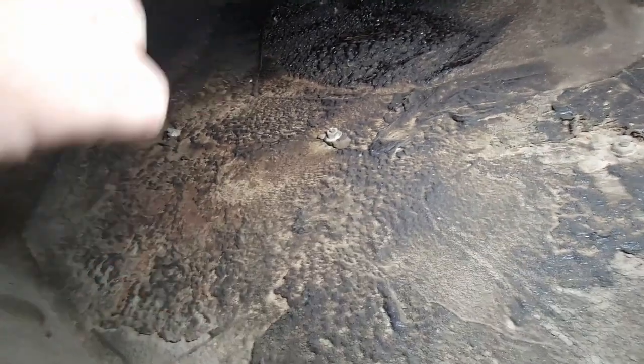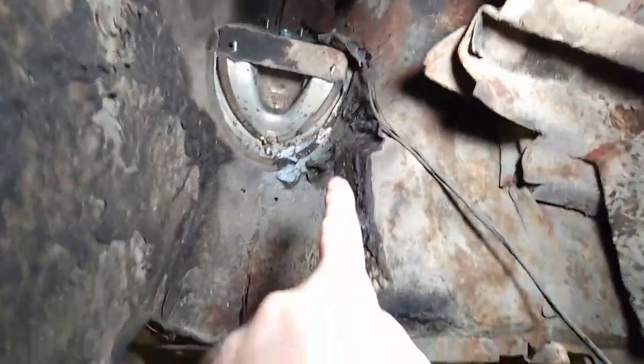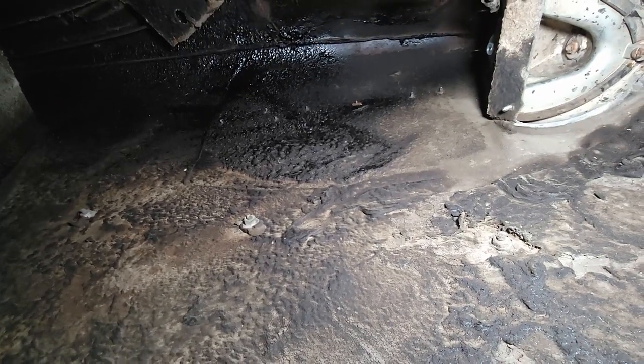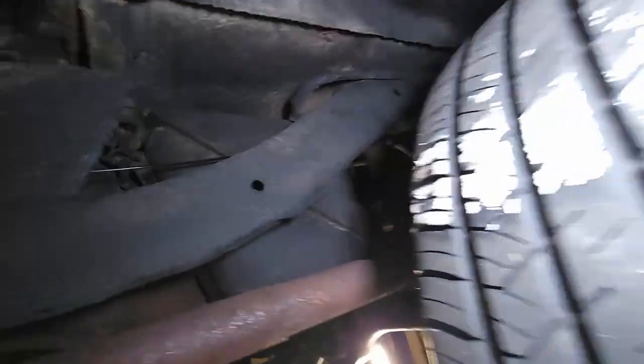And I never did show you guys this. Let me turn you around again. So, showed you that. And the reason we think that's because of a repair is you can see right here. I scabbed in a quarter panel starting up there down to here, which is where that lead is, and came across and out the back. And then it looks like right about here is where they scabbed it in. So yeah, that's not enough. Something hit there hard and they fixed that. I thought maybe, just maybe, the tire had gotten hit. Maybe that messed up the rear end, but none of this has been damaged. There's no damage on any of this framing or any of that stuff.